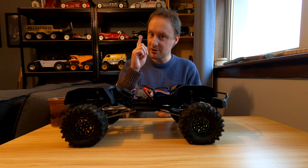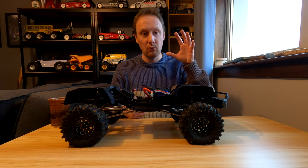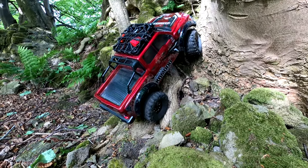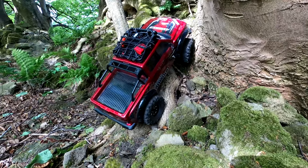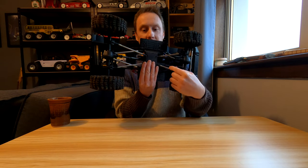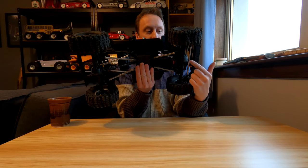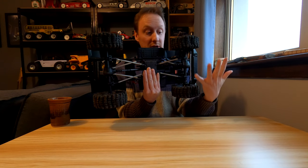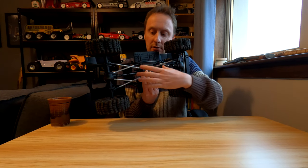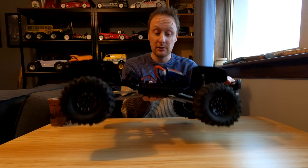There was another issue which I thought was the same issue. But on a crawl, what sounded like the same sort of noise, a very similar noise, wasn't the same noise. The back axle was turning but the front one wasn't — then it grabs again. What threw me was sometimes the drive was getting out of the gearbox and spinning the driveshafts, and then the drive would stop. So we knew the problem was in the front differential, the front axle — because the driveshaft would spin, there'd be a horrible noise, but you'd get no movement. Sometimes the drive would not exit; the driveshafts were not spinning, they would just rumble. So the drive was being lost somewhere in the gearbox. I looked and looked and couldn't find it.